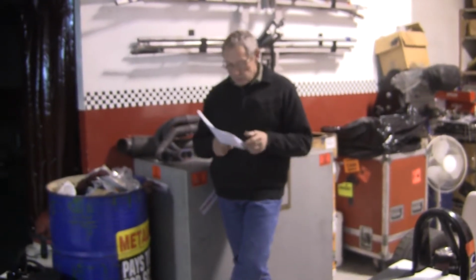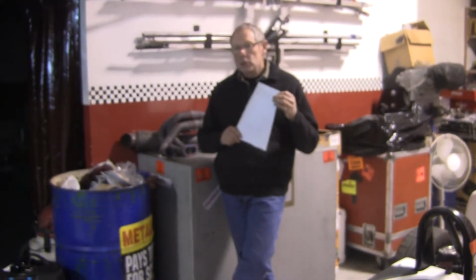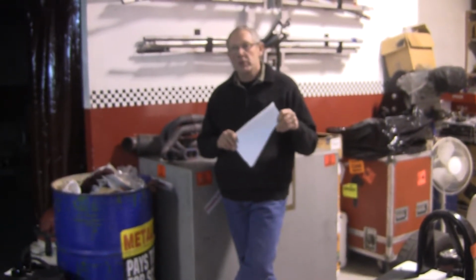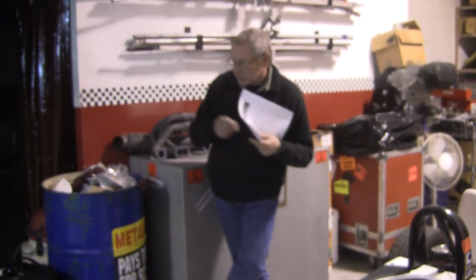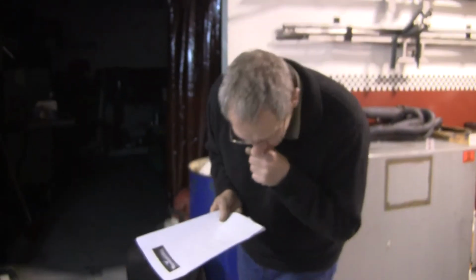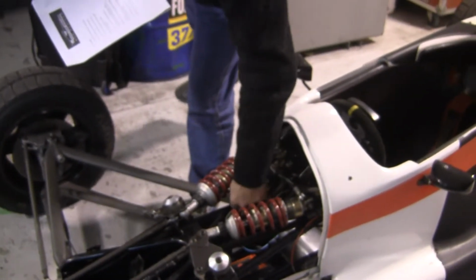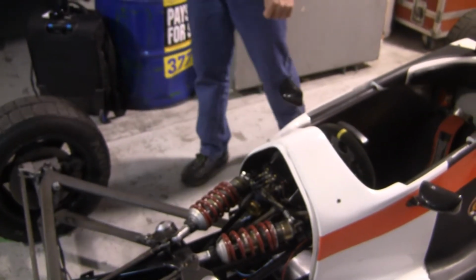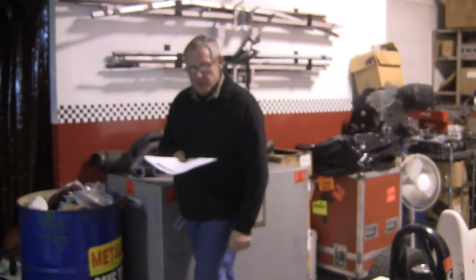So it has to be nitrogen, and nitrogen regulators are generally pretty maxed out at about 150 psi, so you need a pretty good regulator to do that, and a valve and a gauge and stuff. I mean, we've got that facility here if you want to use us to do that. Robert's borrowed the bottle a few times for doing his. But these particular ones don't have a Schrader valve on them, they have a needle. So you need a particularly special piece of equipment to do that. They are a bit of a pain, to be fair.